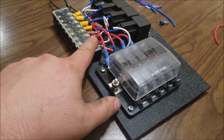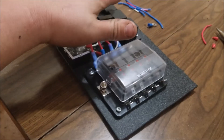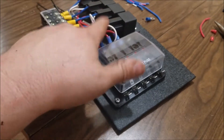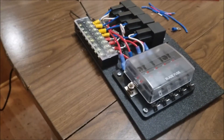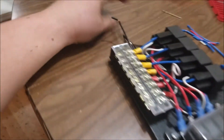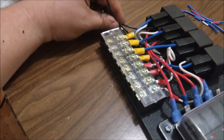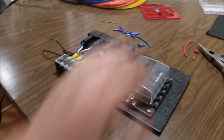The white wires are the switches, so this won't see any power until we hit that switch — hit that switch, hit that switch. It's going to release the power through the blue wire, which is going to run out this side and run to the fuel pump or whatever that relay runs. These are all the grounds, so I'm going to put little ring connectors on there so I can ground them all to a single location so everything will work as it should.